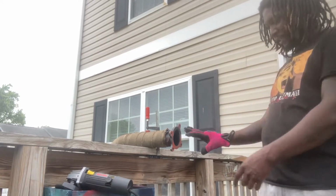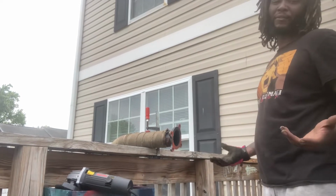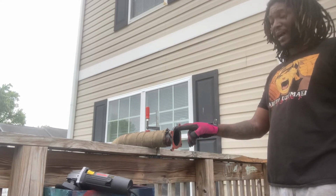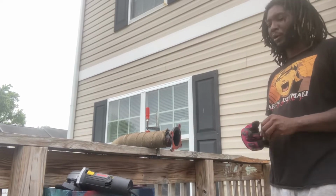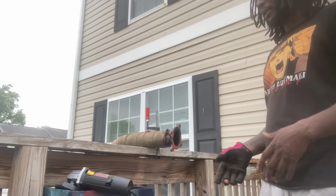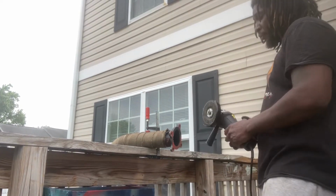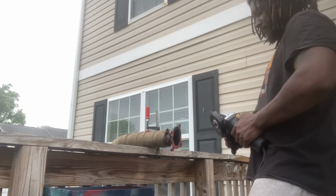I have been doing it. You see how the red shows where it's been flattened out, and obviously the flatter it gets, the more the red is gonna spread out. Right now I'm just grinding the red away so I can flatten it out because I'm having a high spot and a low spot right here. I'm having big leaks, blowing out gaskets and burning them out like the last one I did. So this is gonna replace that. Also, I used a locking pair of vice grips to pull out that broken stud that was inside my turbo. So that's done. Now I'm gonna grind this.